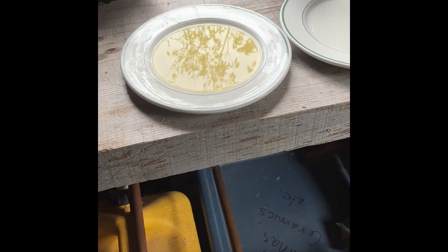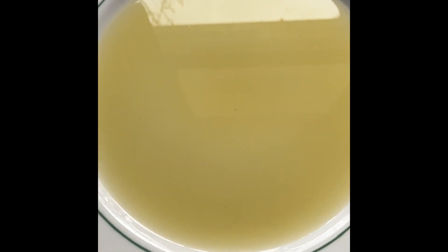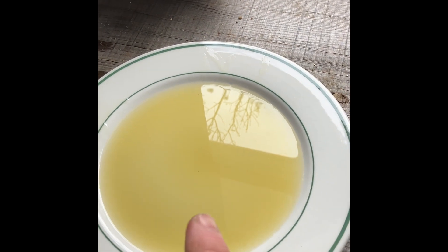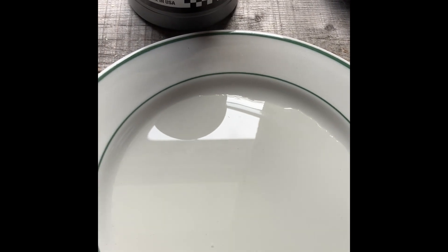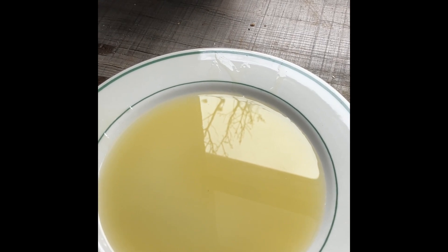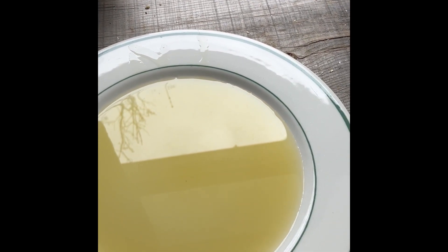I'm going to extract that fluid and take a look at what the reservoir looks like. Here are the results — this is the pretty cloudy and amber color clutch actuator fluid that I pulled out. We'll take a look at the reservoir in a minute. This is just new fluid I poured in — it looks like corn syrup. When I first bought the car I should have taken a picture; we're going to use this as our first control at 5,700 miles.